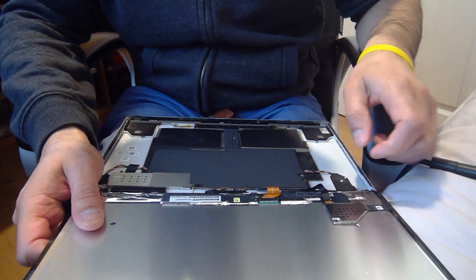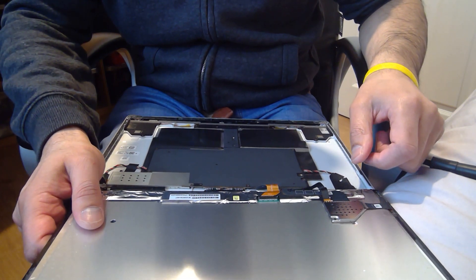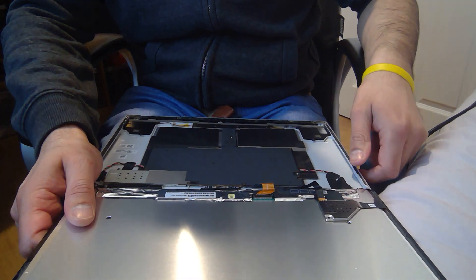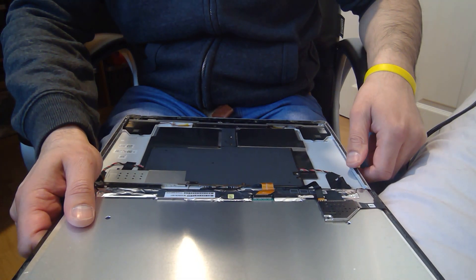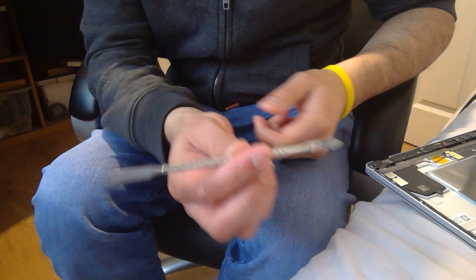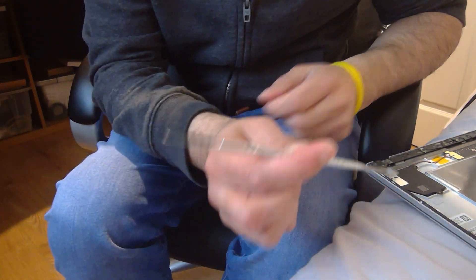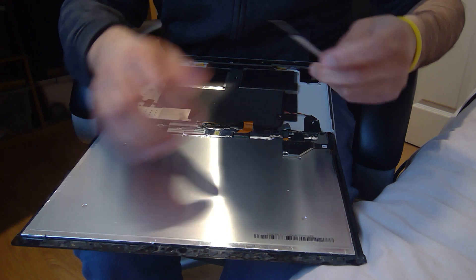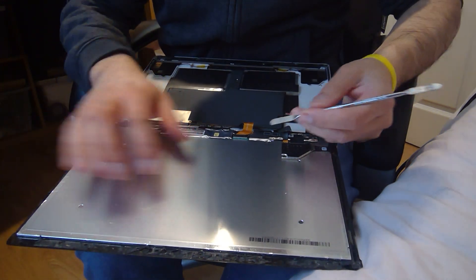I've sheared that antenna cable sticker off but haven't broken it, so I can gently put it back and pop a bit of glue on it — the antenna will be fine. However, if you take it off further up you'll disconnect it from the board and that's a complete loss. To work on the screen you have to take this metal shield off here, this screen off here, and this housing off here. I may need to pause and get a different tool for this.